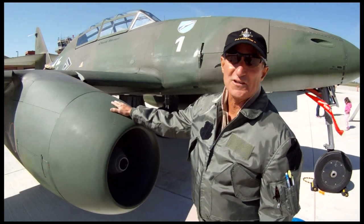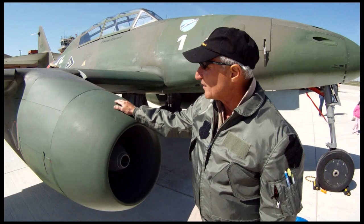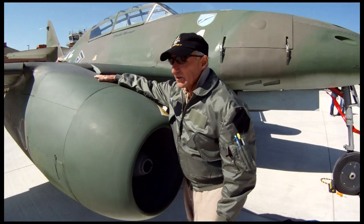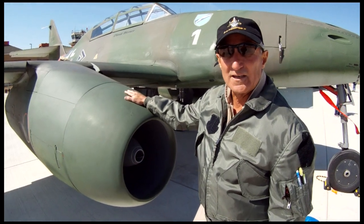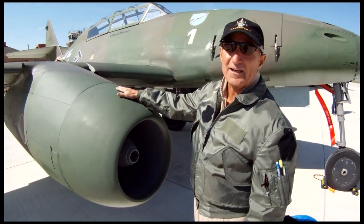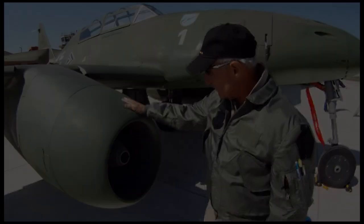But it's a much smaller engine. The engine itself weighs just under 400 pounds. So we have, right up here on the forward edge of the nacelle, a 520-pound weight to counterbalance the lack of size of the J85s compared to the original Jumos.